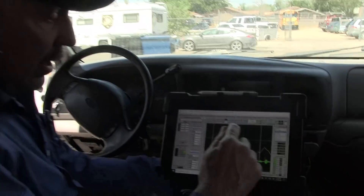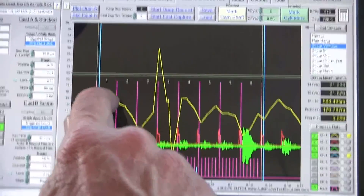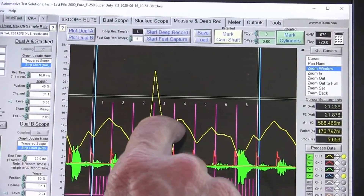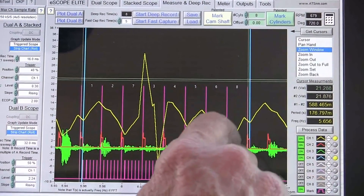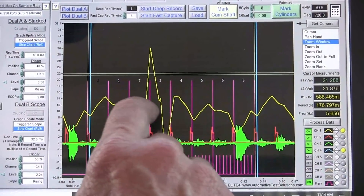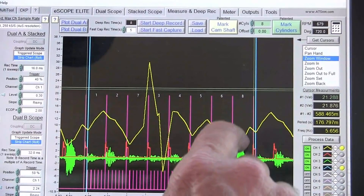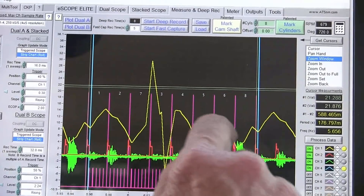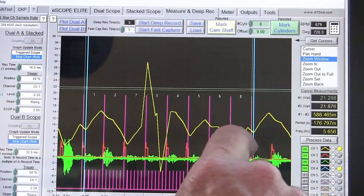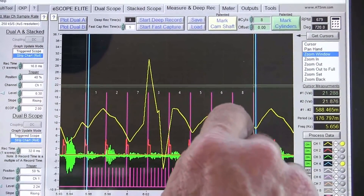We're back at the shop and I want to show you a couple of other things that we get with this waveform. When we're looking at this, this is number one injector to number one injector — so this is the number one fire. Do you see how it increased? Now two is missing, and we've got a miss on four as well. We also got a low fire on six, and eight fires but it comes up after it's leaked. Now the reason that you have two, four, and six misfiring is because eight is leaking. When eight leaks, the combustion gas and high pressure is forced back into the injector and that gets into the fuel rail. So these are being aerated by this leaking injector. That's why you see one bank missing, but eight fires still — the knock is coming from number eight because it didn't seal correctly once we got it hot.